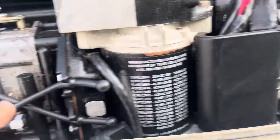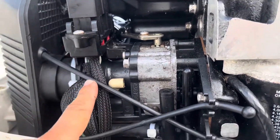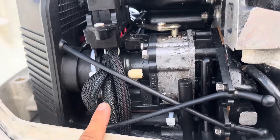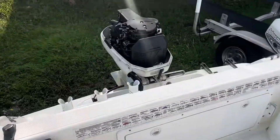One thing — the easiest way to diagnose this problem is to spray carburetor cleaner into the carburetors when you're having the problem. If the engine starts when you spray the carburetor cleaner, then you have a problem with the primers. I'm gonna test it out right now.